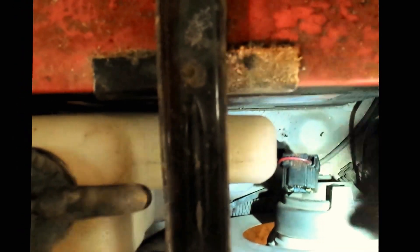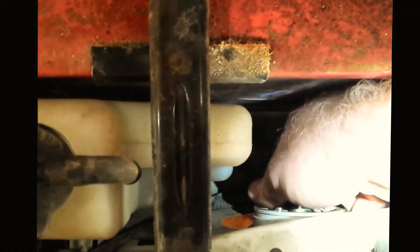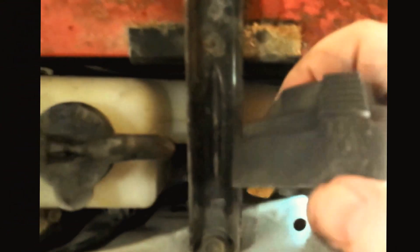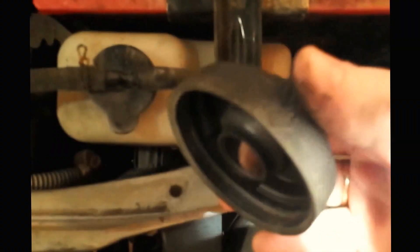As you can see right here, there is the plug. Once you have that removed, you need to remove this rubber grommet. These keep moisture and everything out of the headlights and they're fairly easy to remove as well. Just this tab right here on top — you can pull that and it should come right out just like that. You don't want to lose that; note the orientation of it. It is marked on the cap itself, and that is a very important piece for keeping moisture out of your headlight. Once you have that out, keep it somewhere safe.